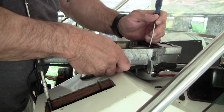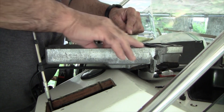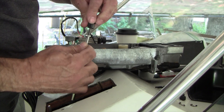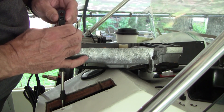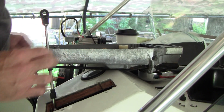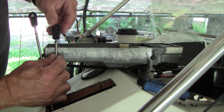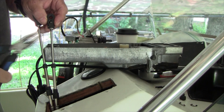I'm going to take the C-clips off — and hopefully not lose them in the process. Unless I have some special adjustment to accommodate, I like threading these on so there's maybe a sixteenth or an eighth of an inch showing through. This goes onto the rod in the direction it is now, and then the C-clip goes over that to lock it in place. This gives us room for adjustment — a lot of room to go out and some room to go in.